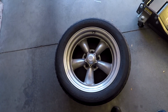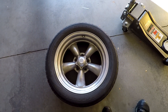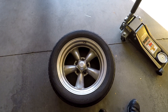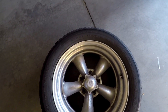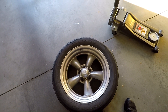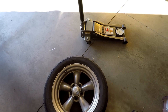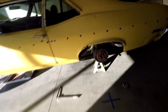The first thing would be the wheels. On the back I have these Torque Thrust tubes - they're 17-inch rims and from the best I can tell without the tire off, I'm pretty sure it's a 17 by 9-inch rim. The tire size is 255/45/17 and the backspacing is more or less like four and a half inches. Like 99.9% of the time they work great - no rubbing or issues.